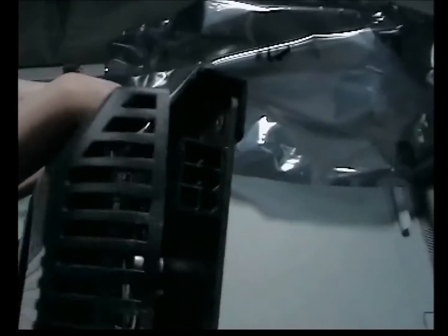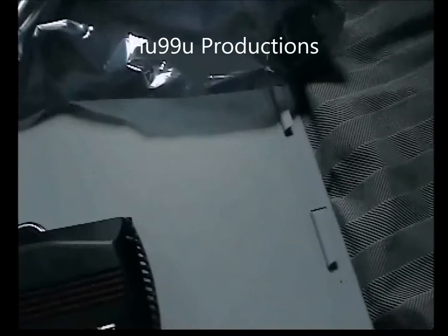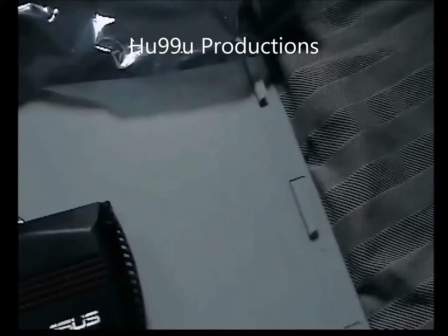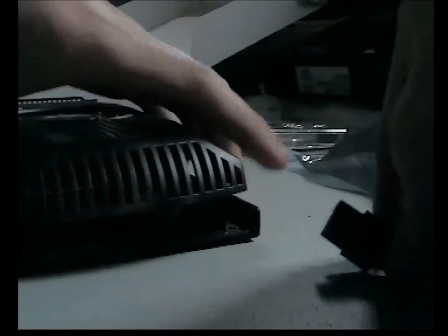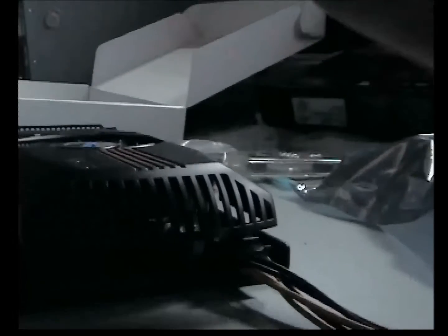But one thing you do not get in the box — I've mentioned this — is that the card has a six-pin plug. But one thing you don't get in the box is one of these cables: a Molex to 6-pin cable. If you want to use this card, you need one of them. In England they're about £3, not even that. In America they're about $4. You need to get one of them. It simply plugs in down here like so — make sure you get it the right way around. That's the connector securely plugged in, and then you plug that into the computer.